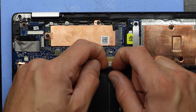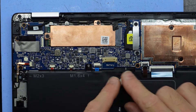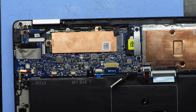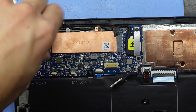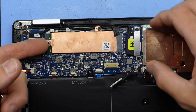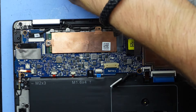I want to pull these two tabs back and lift that up to get the battery disconnected. If you do want to upgrade the NVMe drive, that's also relatively straightforward, granted you will have to reinstall Windows or clone your software prior. This should lift up — there's one more screw over here.